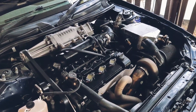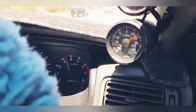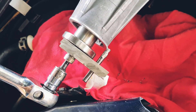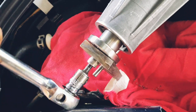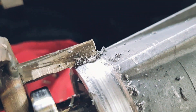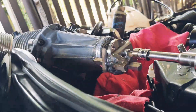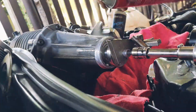Let's give it a test. Look at it — it took 10 pounds pretty much, but I want a little bit more. So we'll put a slightly smaller pulley on — that'll give us a little bit more boost. But I need to machine down the snout. I decided to do it by hand, which took a very long time.